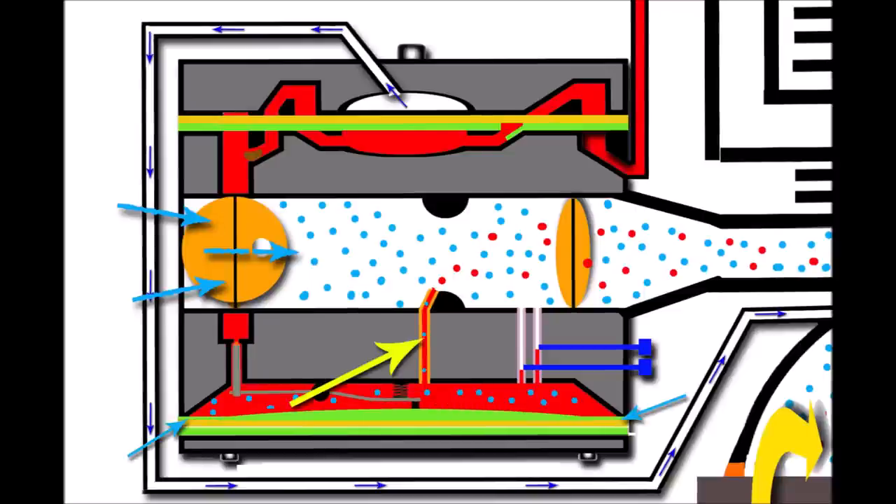The effect is twofold. First, we've got air mixed in with the fuel, so when the jet draws out the fuel it's already mixed with air, upsetting the fuel-air ratio because we don't have neat fuel coming out — that means not enough fuel to keep the engine running. Second, because the back of the metering lever is only partially pushed upwards by a partially expanded diaphragm, the front of the metering lever is only partially back, meaning there's less gap allowed by the metering needle — less fuel allowed to flow into the metering area, meaning less fuel available to be drawn up into the carburetor.